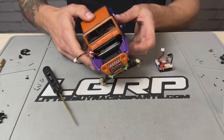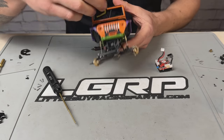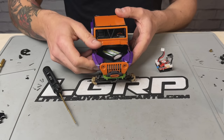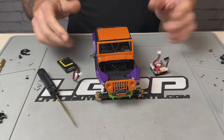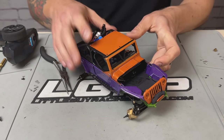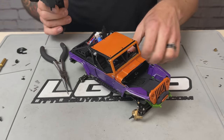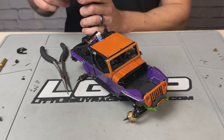With the velcro setup, once the battery pops in it doesn't go anywhere. There's plenty of room — I just want to make sure there's no interference with the motor. It gives me versatility on battery placement and the hood will go over that. I'll need to run thin batteries to fit, but that's fine. Next step is plugging everything in, putting the tires and wheels on, then firing it up. I've binded the Avatar to the ESC, got a battery in, and let's check for steering and power.